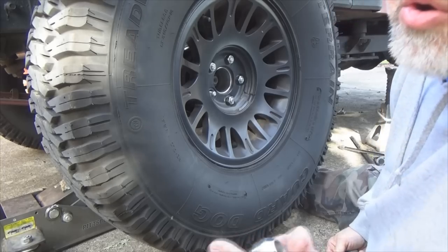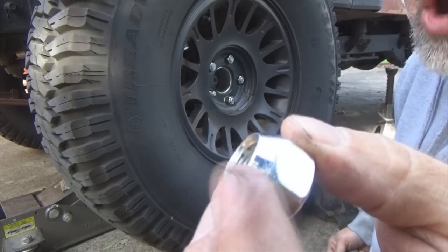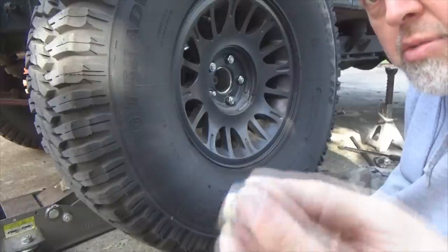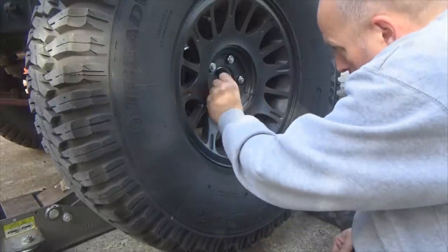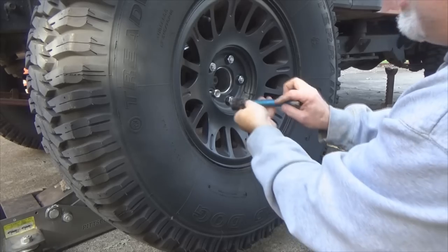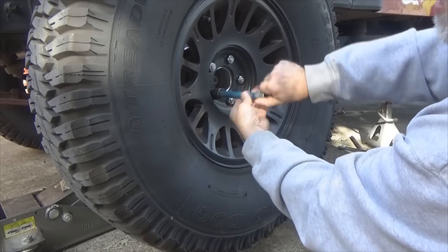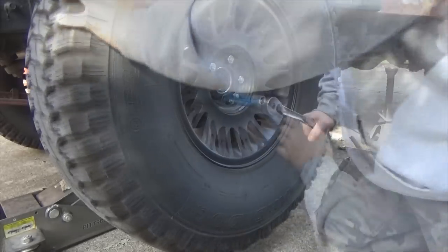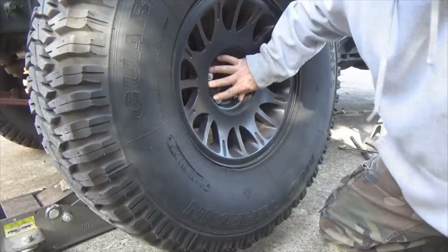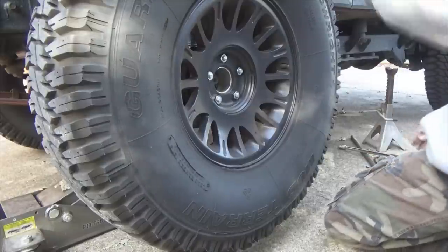And for the people out there who are newbies to this whole thing, the conical shape right here, your cone shape, goes inward to the wheel. See how I've got to position my fingers? That way. I know some people are going to say, really, Chuck, you went into that much detail? Yes, I did. Not everybody's cranked wrenches out there, people. Remember that. Now, all the thing I've done right now, I've got them good, hard, snug. And now I'm going to pull the jack stand out.